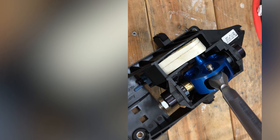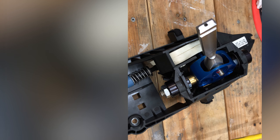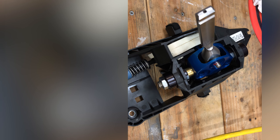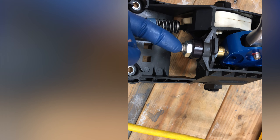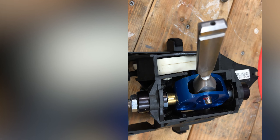I'm in the process of installing some numeric shift cables, hoping that'll take care of some of my slop. Now that I've got my shifter apart I'm finding some other slop I wanted to share. Part of my slop — if I lock the shift block here and go back and forth — that's about three to four thousandths. I'm going to either try to find some shim stock or use a feeler gauge cut to fit down in there. I put the feeler gauge down in there and it really tightens things up and makes it feel nice.